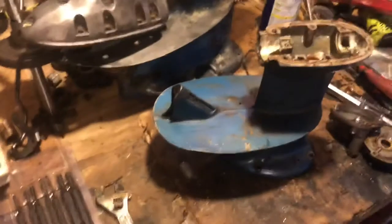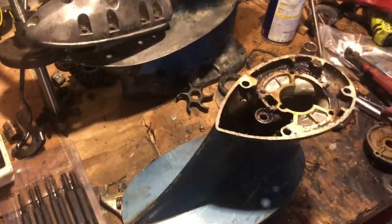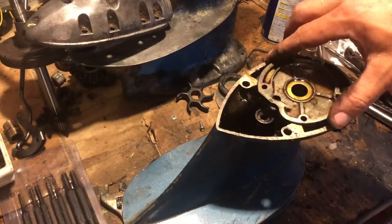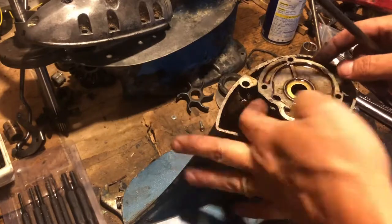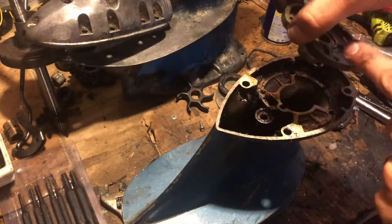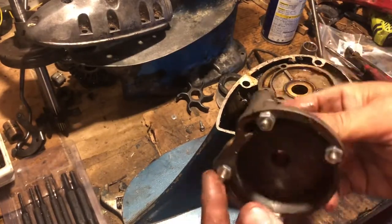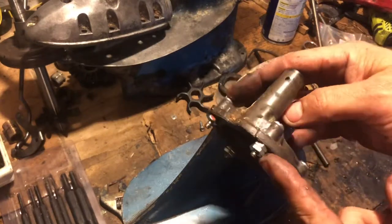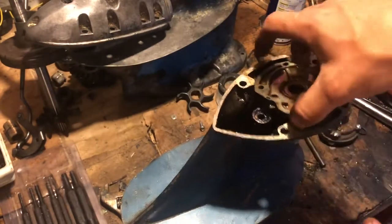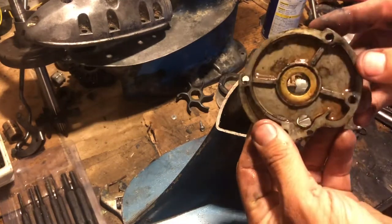Easy peasy, for the first time ever. Okay, so we have to reseal this motor — this one's got the plate. These plates are expensive, you don't want to crack them. From Brandon's Garage: he takes the water pump housing, puts a screw through it with four nuts, grips it, puts a wrench on it and turns it — that breaks the seal loose. A lot of times you can wiggle it up and pop it right out.